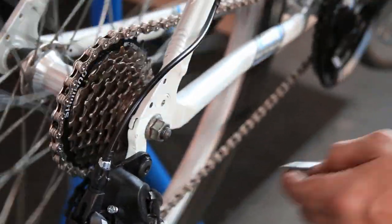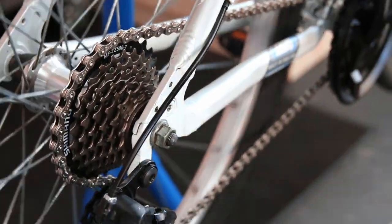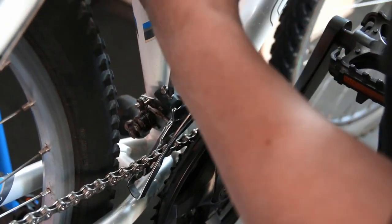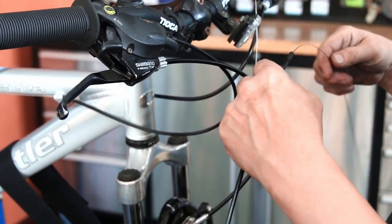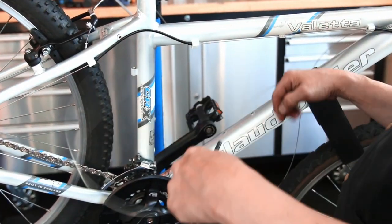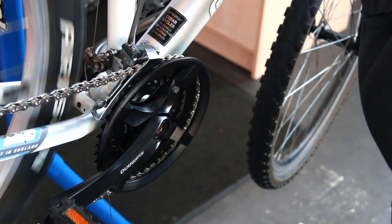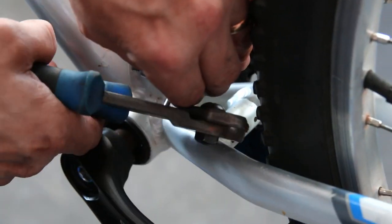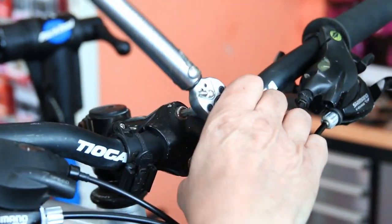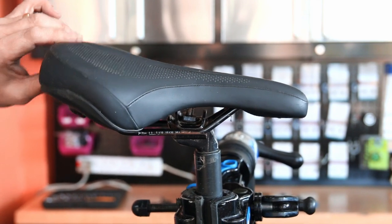It was made all the more pleasurable by the fact that the owner is someone I used to do judo with many years ago — I did judo for over 20 years. We're now adjusting all the gears. I always do the rear first, then the front derailleur, because the low setting on the front has to be done in gear one on the rear. I'm using stainless steel cables throughout — I don't use galvanised steel cables because they stretch more. Stainless steel cables are much better. Whether it's a budget bike or a £10,000 bike, I always use the best cables.